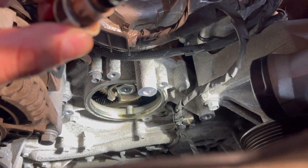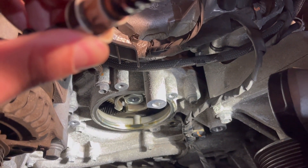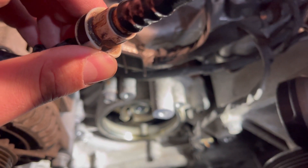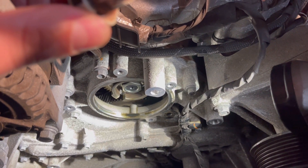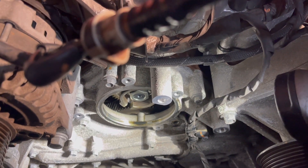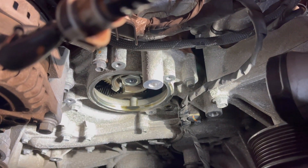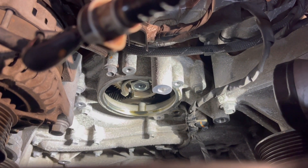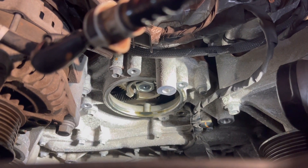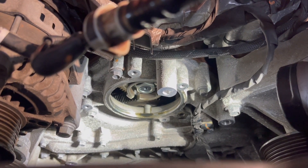This is the vacuum pump that sits over top of where the timing gear is. The unfortunate part is I can't turn the motor over to time it, because I tried clockwise and it just wouldn't budge. As soon as I came back counterclockwise, I'd loosen that nut up. We might have to just try and make our own marks or something and then do it that way.